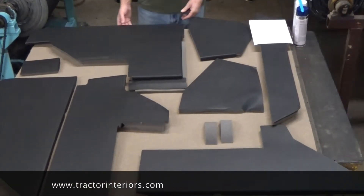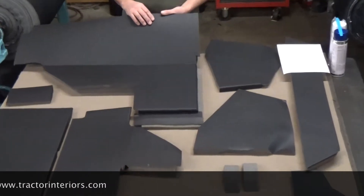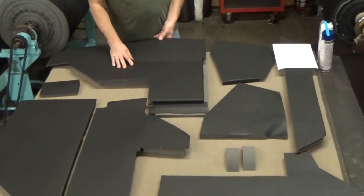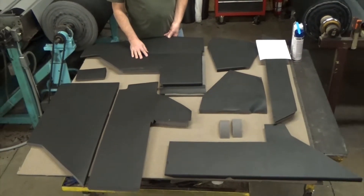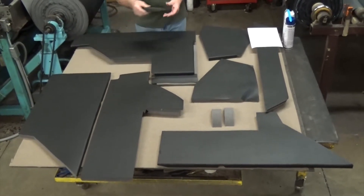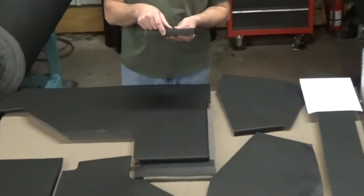All of these parts are made of perforated black vinyl. The perforations are in this vinyl so sound can go through those holes and be absorbed into the foam in the back. The foam in the back is a special type of foam made for sound absorption. This part is considerably better than original equipment — we've added foam to this, and we've put a lot of hot wire cuts in what I call rolled or finished edges, where there's no exposed foam on the pieces.